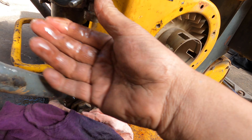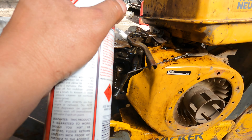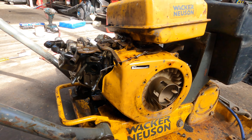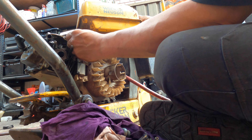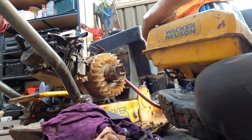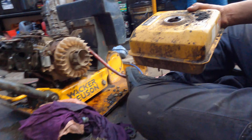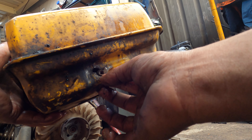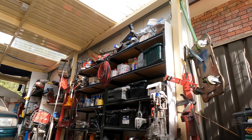Now turn off this one, pull the whole tank out, and clean the tank as well. Then we spray in here, pop off the spark plugs, and get an air gun to blow everything away. In here it's a big dark yellowish mess — oh my lord, very dirty. And here is a rift on the tank. Normally when you've got wobbling you'll see rifts like this, so we fix it too. We're gonna put everything back together with the tank.